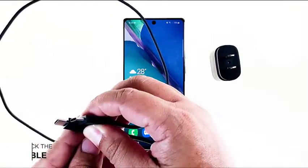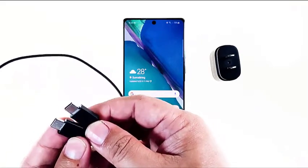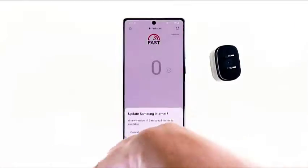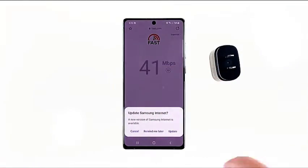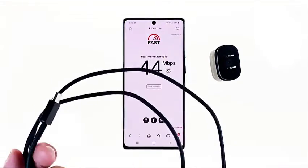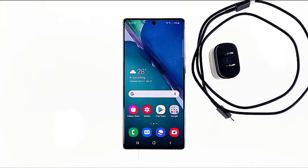Next, check the cable. The cable bridges your phone and the charger — if it's broken, the current may not reach your device. Make sure that the connectors on both ends aren't wet or obstructed by any debris or lint. If they seem dirty, you can soak them in alcohol and wipe them off with a dry cloth. It's easier to clean USB-C cables as they're larger. You may also run your fingers from one end to the other to check if it's broken somewhere.